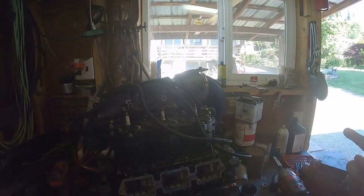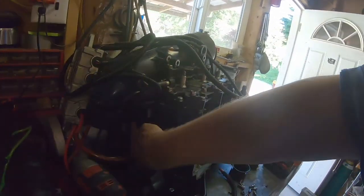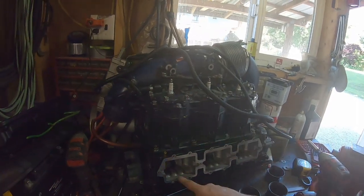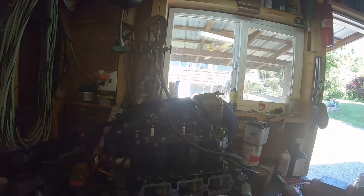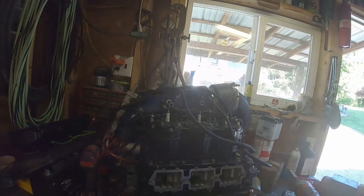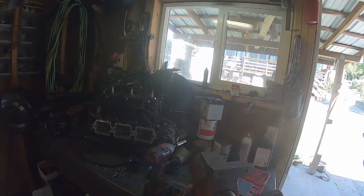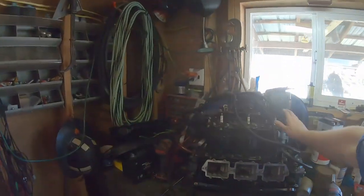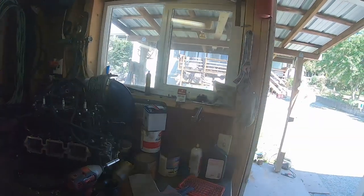The other engine also had a water leakage on the water box gasket right here, so the back cylinder was getting water — it was all milky in there. I'd torn that one all down to find the water leak and verify I got everything taken care of on these engines. You guys saw they did run. This engine actually ran a good lap time, working well wide open, but it was having trouble in the idle area.